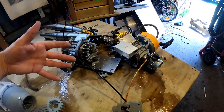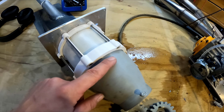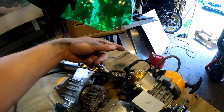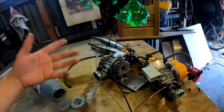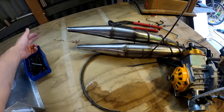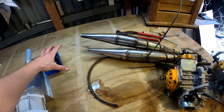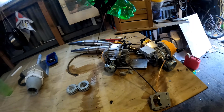The cooling system seems to be working — I couldn't believe there were no leaks. The water is going to feed from this side of the jet unit, go into that pipe, get preheated by the exhaust, then through the cylinders and dump out the front of the board so I can see it. I've still got to put the small diameter pipes on the end, bend them around, make a water box exhaust with some sort of one-way valve, and make the board — so plenty to do. Thanks for watching guys, see you next time.